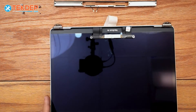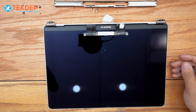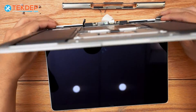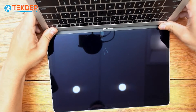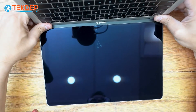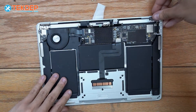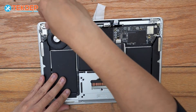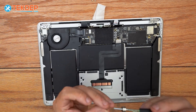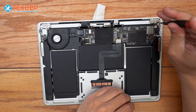We're going to flip the screen around and leave the hinges towards the top for reinstallation. Now we'll take the top case assembly, making sure we don't get the wire caught, open it up, and set the hinges in their hinge locations. We'll hold the hinges as we close the LCD — that's our top case and new LCD assembly all together. Now we'll secure the six T8 screws on either end.